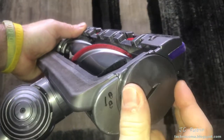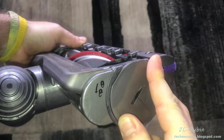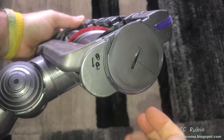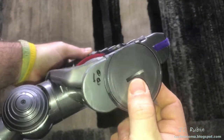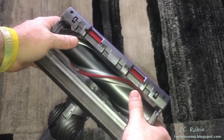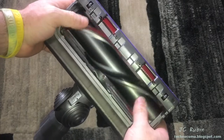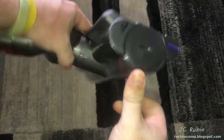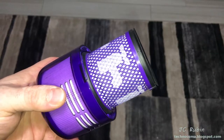I slide the brush back in with a spinning motion to get the bristles through until it fully seats. Then I spin this end cap until it falls into place - you'll see right where the flat spot sinks down. Using the coin in the locking direction, I lock it until the flat spot is pointing down. I check for binding, make sure it spins freely - it does, and this portion of maintenance for the torque drive head is now done.